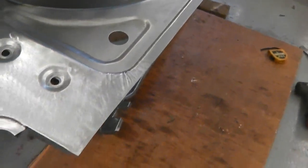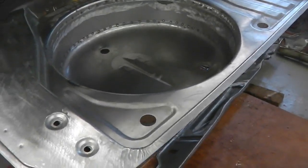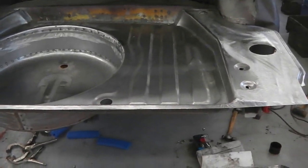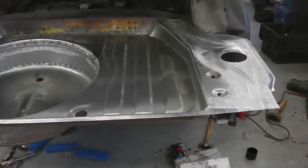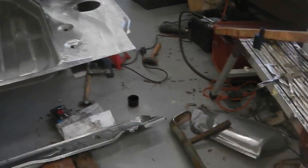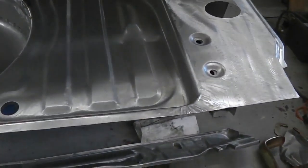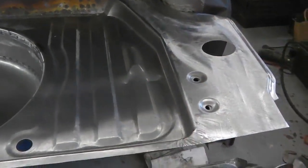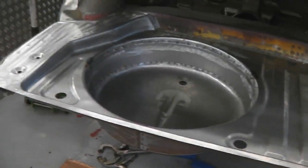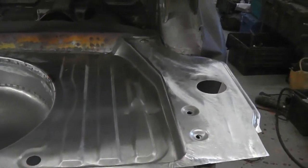So chassis legs, then we're happy that that's where they go, which means now we take the boot floor off, and weld the chassis legs up in the position that they are. But before we do that, we'll brace them out at the back with the bumper bolts, just to stop them moving when we weld it, so we can use that bumper there as a brace piece. So we'll bolt the bumper on, and that'll keep them from trying to pull inwards a little bit. If any weld goes, they're going to be braced in position for the exact 123 spacing between them. So the boot tub can come off, the bumper goes on, then we weld on the legs where they are now because they're right.